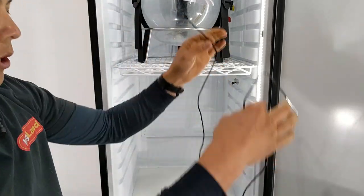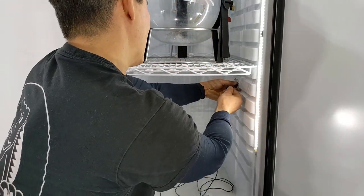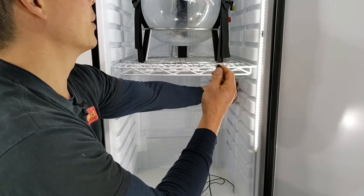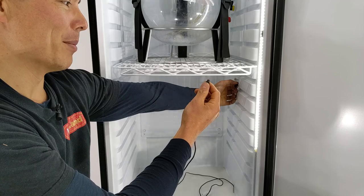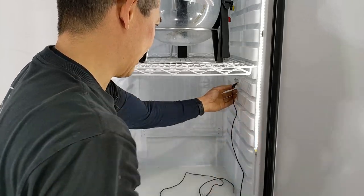Then you've got the longer probe if you want to put this aftermarket extension probe in. Clip that in — now there's no polarity with these types of NTC probes, however we do have a little clip which will force you to put it in one way. The fridge will also make a beeping sound when you've got the probe unplugged, so that error sound will come up — that's completely normal. Then plug this in like so.